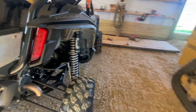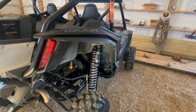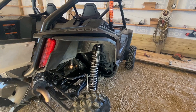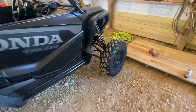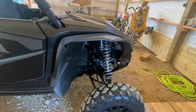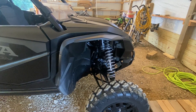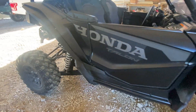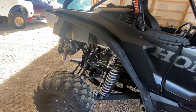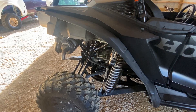So yeah, Shock Therapy springs — I think they're worth it. Their preload settings were way off though, so I had to adjust that; their guide is just a guide, so depending on your rig and what you're doing with it, check your ride height. When I first put the springs on my ride height was at like 19 inches — it was like climbing into a lifted Jeep. Once I cranked it down and got the crossover set, it was much better. Next up is some valving work on these shocks — I need a little more rebound control and I think we'll be in good shape. Thanks for watching, stay tuned.